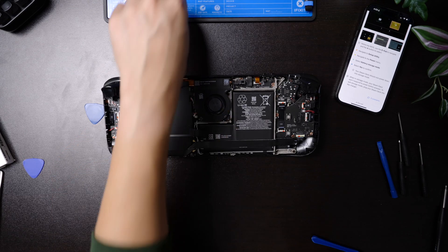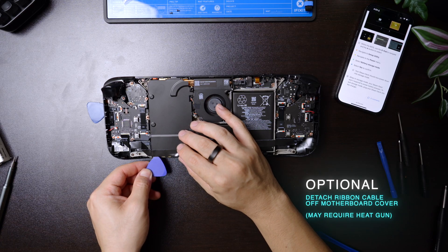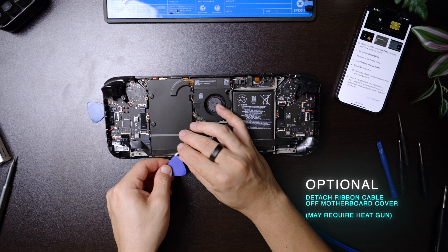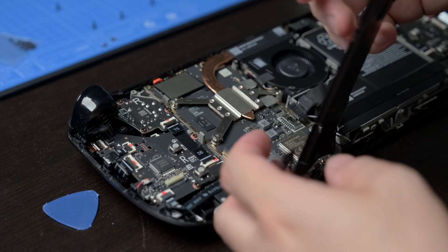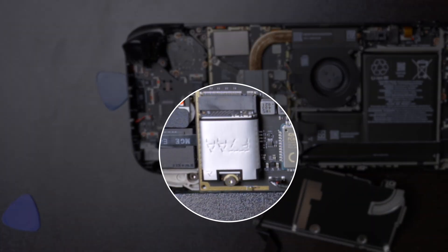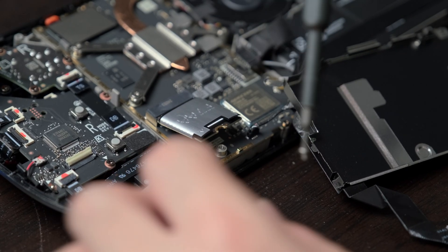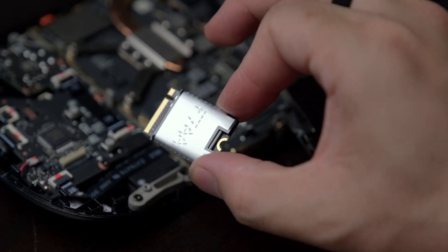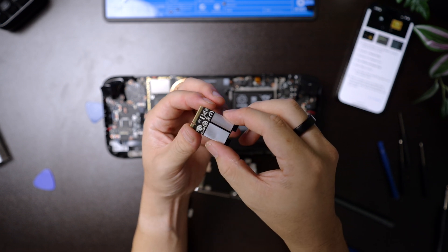Once that's removed, there are two more Torx screws holding the motherboard cover on. Once that's done, the cover can be flipped or removed. If you want to remove the cover completely, you'll also have to detach the ribbon cable from the cover, and that's a little bit of a task — you might need a heat gun to soften up the adhesive. I couldn't be bothered, so I very carefully lifted the cover up and flipped it, making sure the ribbon cable wasn't getting bent too much. Once flipped over, you can see that little stock SSD sitting there with a little EMF shield on top. Remove the Torx screw holding it down and the SSD will spring up. Go ahead and remove the SSD — and grab that little EMF shield too, as we're going to use it a little bit later.